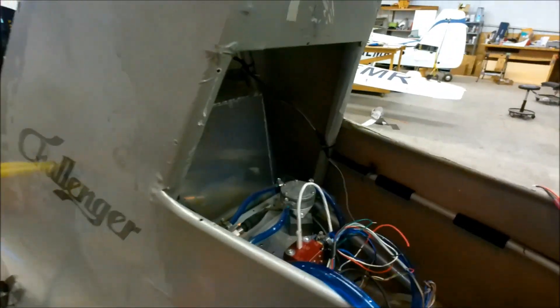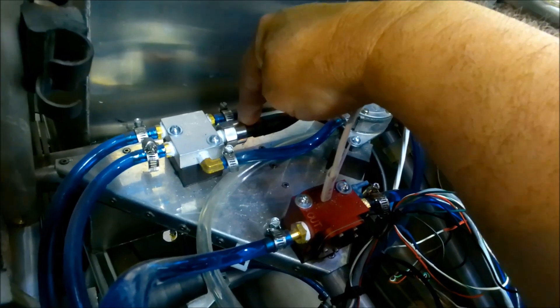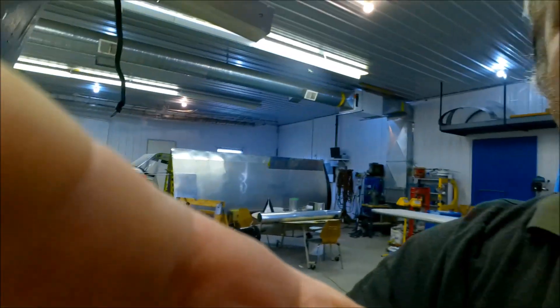So that's why I cut that wire and measured the voltage — it's within spec of the manufacturer. It wouldn't be zero volts; there's going to be some voltage there. And 0.5, 0.48, 0.45 volts — that makes sense, because there is a solid-state device inside the pressure sensor. This little sensor here — it's not just a resistive element. There is an actual solid-state device inside these; I managed to get an exploded diagram and there is a microchip inside there. Anyway, 0.45 to 0.46 volts is actually what it was. That's going to be zero. So let's go back to the EIS and the EFIS.